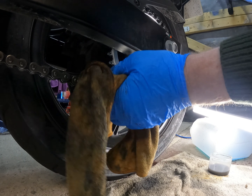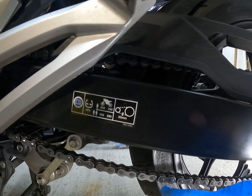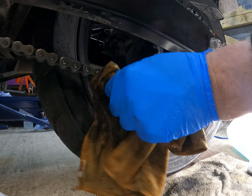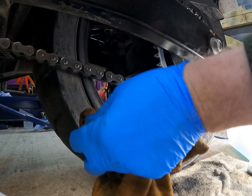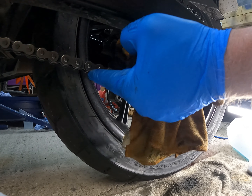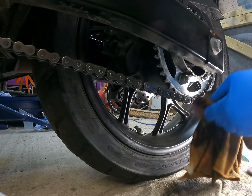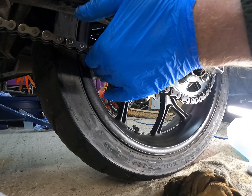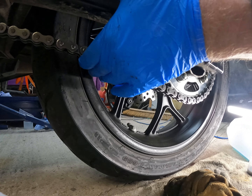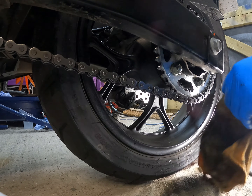You check the chain on two sides — if you look on your swing arm on new ones it will tell you. So that's 30mm, I need to get a rule and measure that. I'm not OCD about doing things absolutely perfect, but if it's too tight it's going to do damage, and if it's too loose it's going to do damage. Generally about half an inch to an inch max is enough. That may actually be a wee bit too loose — I need to just nip that up a little bit. But my concern there is that knocking sound — I don't want that at all.